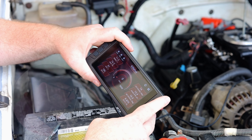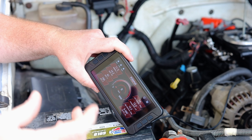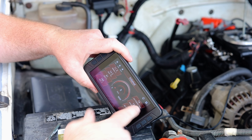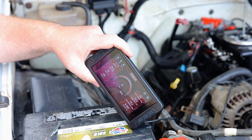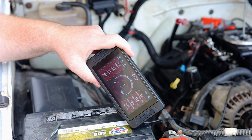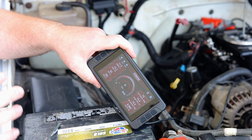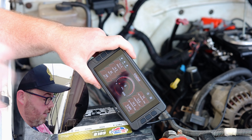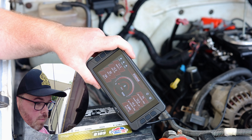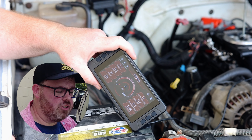Also, as we saw earlier in the video, when the IAC thinks the throttle is open — TPS being open — it'll go to its parked position, which was around 30 or 40. But as you're cruising down the road, the IAC position will move in and out depending on engine load. If you're really getting into the throttle, you'll notice the IAC position increases a little to help with calculated airflow over the throttle blades, giving a bit of extra air where it matters for tip-in and other calculations. I hope this helps get your engine set up just right.